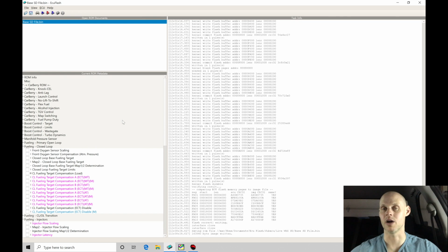This is a Carberry ROM, so we have the ability to flop between MAF or MAP speed density based mode, or the hybrid between both of them. So we're going to look at that technique and just doing the general blending, and tuning each individual operation within this training tutorial. We're going to do the fuel tuning, take a look at idle, part throttle, wide open throttle, in both MAF and speed density. Next video we'll look at spark timing tuning, and then the video after that we'll look at the boost control.